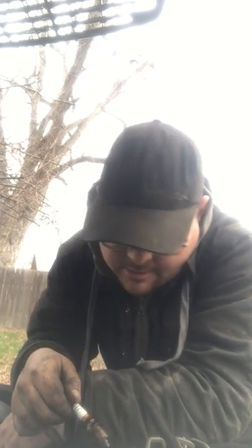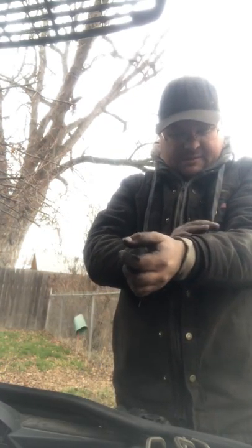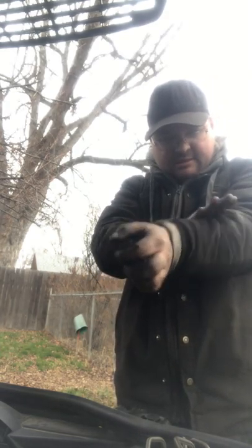But that tells me that she has been leaking. So I gotta take off the top valve cover and the bottom valve cover, because they're both leaking. And I gotta do the same to the other side. Might as well, because don't do one at a time. Do them in pairs, okay? So I'm gonna take this off. I didn't want to see this, but now I gotta go clean this thing up. I'm gonna just use my coat and call it good, you know? Just wipe it off on me.